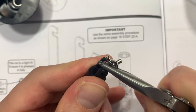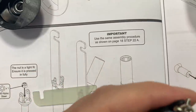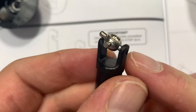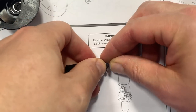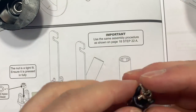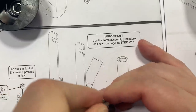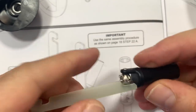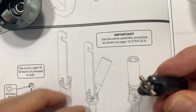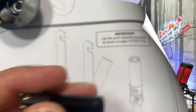This can be a bit fiddly, so take your time. I found needle nose pliers were a good way to start — you push the first pin through the hole just a little bit, then place it on a piece of paper and push down to make sure the rod goes all the way into the hole. That helps when applying the provided tool — slide it in so it's all the way over, then push down and it should click into place. It takes a reasonable amount of force but don't overdo it. That's the only real challenge — it can be a bit frustrating.